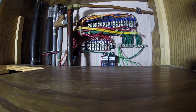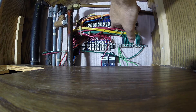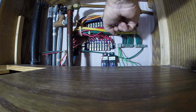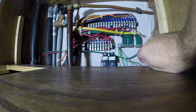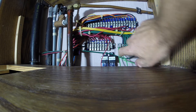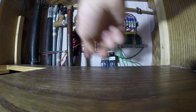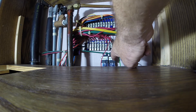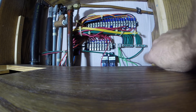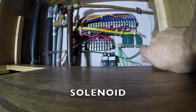As I showed before, we've run up a constant 12 volts here, and we've run up a key-on 12 volts here - we're just going to use that one for signal. This one right here is power to the rear thermostat. We're going to use that one to control the Webasto relay. So when we turn the Webasto on, this thermostat will get power, and that will open this relay. This relay will allow the solenoid in the coolant system to open and flow coolant. Whenever the Webasto's on, coolant's flowing. The key-on is thermostatically controlled. There's a 140-degree thermostat in line with this key-on signal. Power comes to the 12 volts here, goes down through the thermostat, comes back up to the relay, and then out to ground. As long as the thermostat is closed, we will have key-on power opening the solenoid. When the thermostat on the water tank has reached 140 degrees, it'll open that circuit and the solenoid will close.